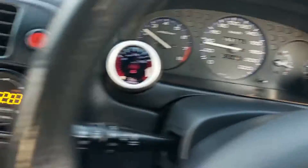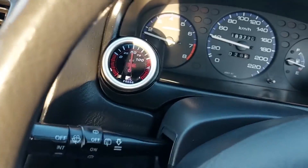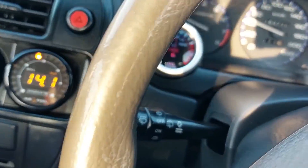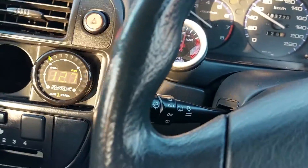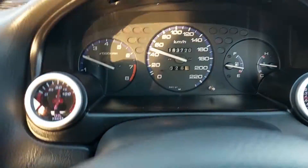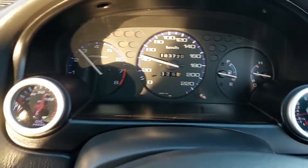Okay guys, doing a bit of testing — the gauge is working perfectly. I'm trying to get it to not cruise at 10 air-fuel ratio. It's looking okay — doing 13s and 14s now. A little bit of street tuning, and as I'm moving the fuel map around it is changing on the gauge, so we know the gauge is calibrated and working perfectly. Anyway guys, thanks for watching — please like, comment, subscribe. I'll see you all in the next one.